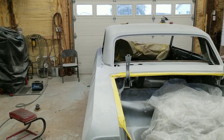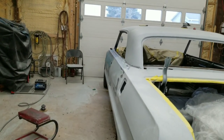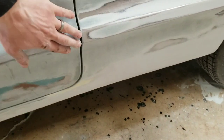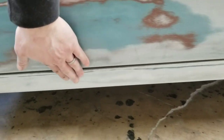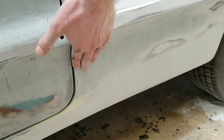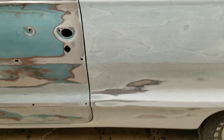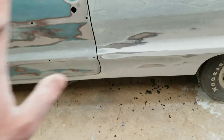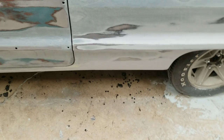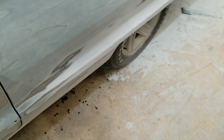You can see down through here — all our panels are perfectly flush down the side, everything lines up exactly how it's supposed to. The gaps are not terrible; didn't really need any filler here, this stuff flushed out real nice on its own. There's a slight bit of filler here, but remember: put plenty on and then sand it off. It's almost all gone now, sanded off, we're right where we need to be.